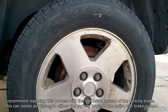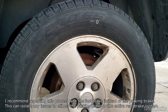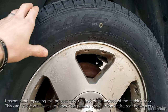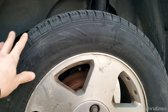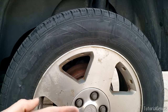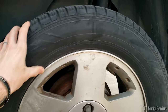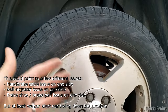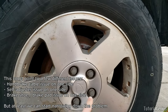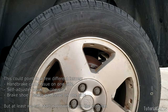The fact that both wheels are kind of the same is a good indication the cable may just be a little stretched and needs fixing. However, if your driver's side is loose but your passenger side is stiff, we can isolate the problem — something is specifically wrong with the driver's side. It could be a seized handbrake line on that side. This is a quick and useful test to diagnose the issue.